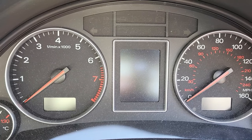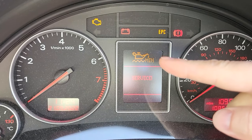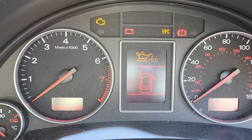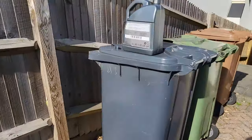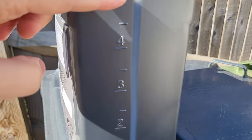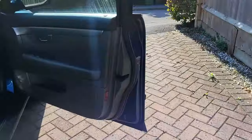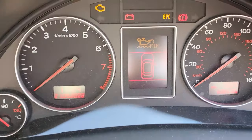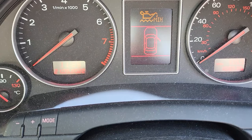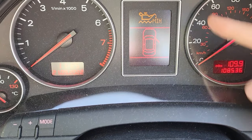Recently my car has been coming up with a warning on the dash — this symbol tells me that my oil is at a minimum level. Conveniently my car also needed a service, so I've just serviced it and took out five litres of old oil, as you can see in this container — just under five litres. I wouldn't have thought five litres for a car that normally takes six would trigger a minimum oil level warning. But I'm confident that having filled it back up with six litres — the capacity is 6.3 on this car — that should be enough to extinguish this symbol.